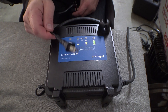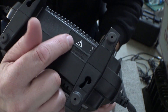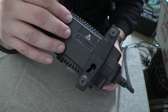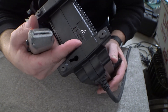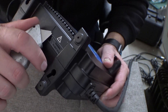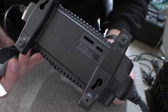Very important — unplug this from the wall before you continue. I'm going to repeat myself several times here. If we flip this thing over and look at the bottom, we've got some random warning and then there's a little sticker right here that has an exclamation mark on it. Underneath this sticker is where the secret switch is located that allows us to take this thing from 10-amp mode and put it back into 8-amp mode, which is widely compatible with the older chairs before Volt Pro came out. Get a knife or similar to get under the edge of the sticker and peel it off. It's best to save this sticker — it is actually metalized, almost like it was designed to be taken on and off. When we peel this off, we have a couple of holes that lead into the inside of the charger, so cover that back up when you're done.